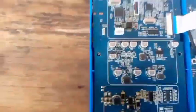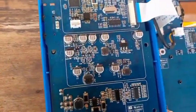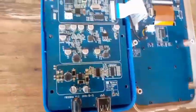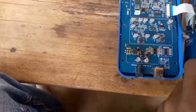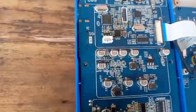This is not a screen problem. This is the flash IC — I'm going to remove it and program it with a TVP 2588U+ multi-flash BIOS programmer to reprogram the software. The reason it is not displaying is that the software is corrupt — the BIOS chip is corrupted.